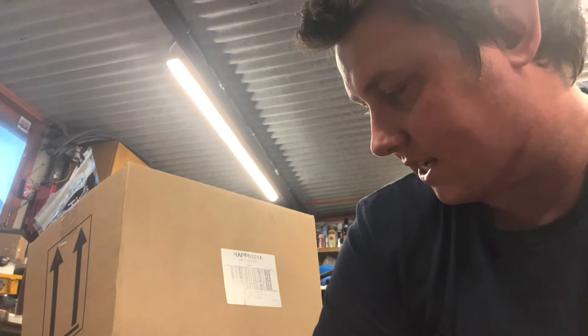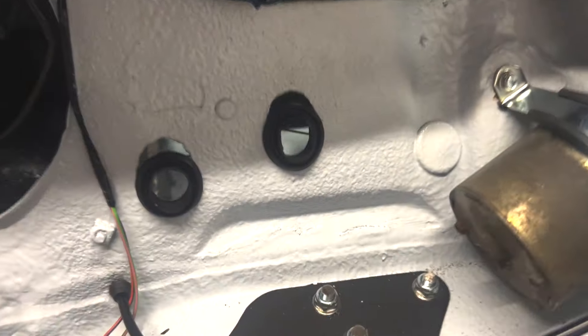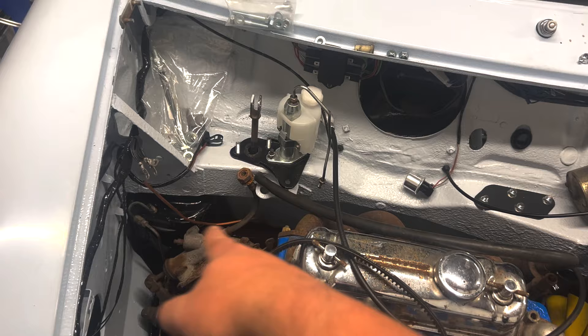The priority this evening is to get the radiator fitted in, then tidy up, do a little bit of paint on the cover, and polish up that radiator. A little bit of Autosol on it will bring it up lovely. New flexi hose — if anyone can point me in the direction of the correct bungs for these, because I shouldn't be able to lift these. I've got the new clutch hose — nut, washer, and banjo — so that'll be sorted. I can put the servo in then, get the unions onto the brake lines so they can be connected, and the compensator can go in.